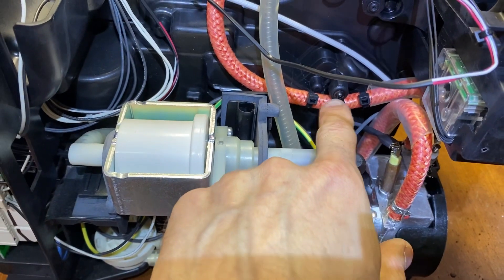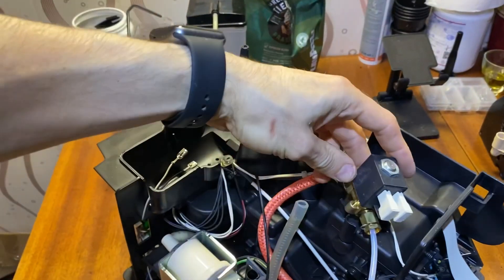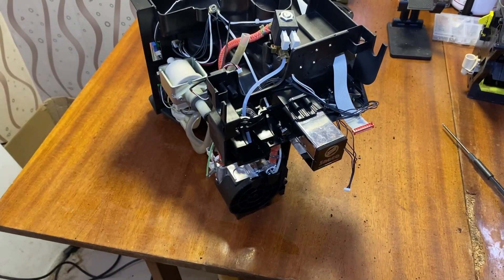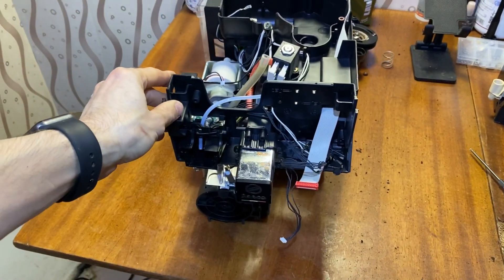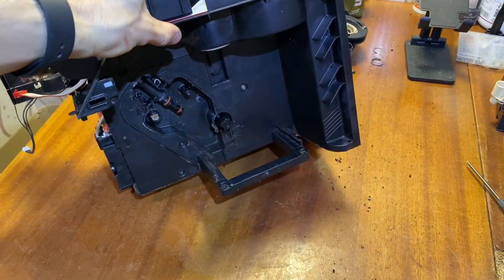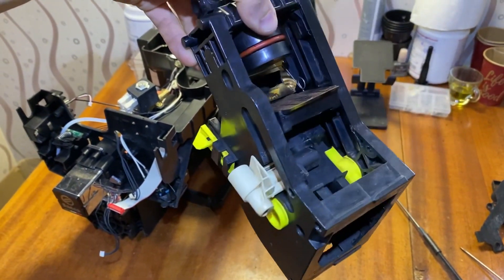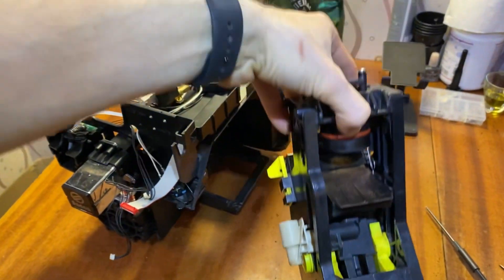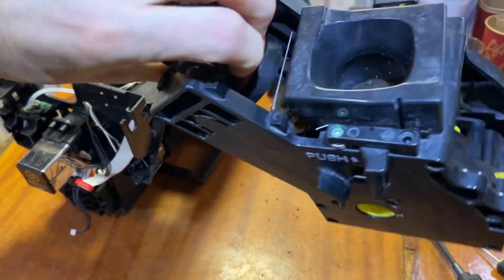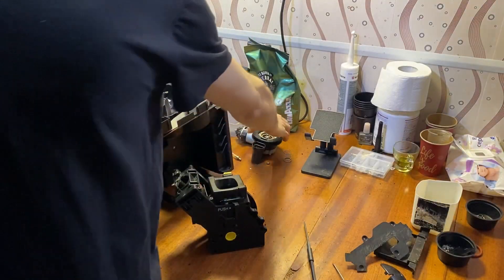Some machines can develop a broken triangle or trident fitting. If it has leaks, you must replace it. It may also be the electro valve — when you don't get water from the spout, don't get steam, or can't make any milk beverages, address the problem to this electro valve. Sometimes problems can also arise with the brew unit — it can have a broken water inlet, broken rings, or scratches on the cylinder.